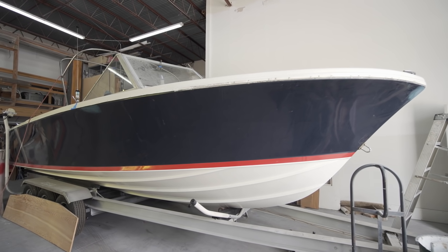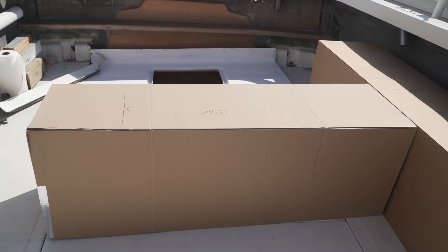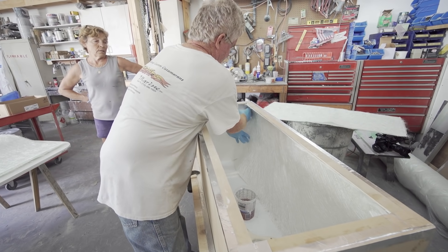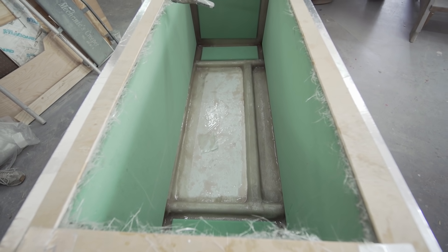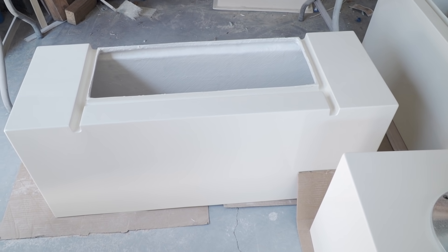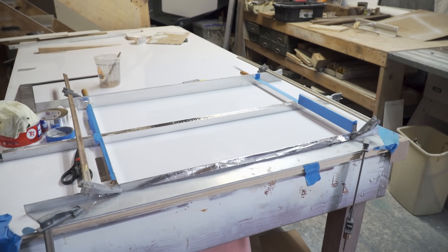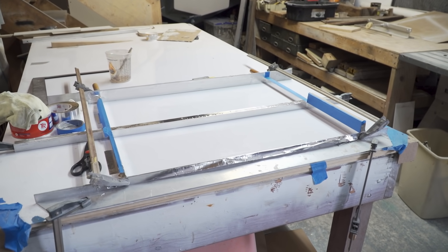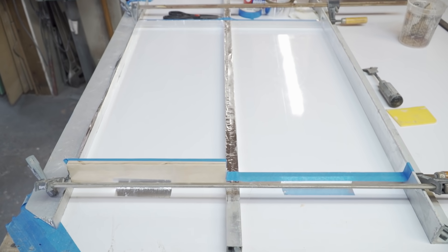Here at Wildfire we're still working on Dave Taylor's 25-foot Bertram IO conversion. We went ahead and built all of the seats that we had mocked up — Dave came up with some sizes that he wanted, so we made our temporary molds and built four seats. After finishing and painting those, we now need to make all the lids for the seats. They're two odd sizes, so I went ahead and laid up a couple pieces of angle aluminum with foil facing on them on our Formica table.